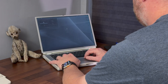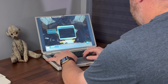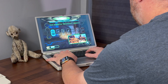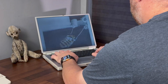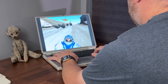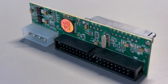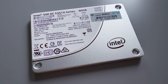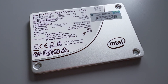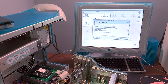Swapping out the drive in the PowerBook G4 was nice and easy — nine screws on the bottom and you have immediate access to the drive. The iBook on the other hand requires almost complete disassembly; I've done it once before and decided never again, so I'll stick with the mechanical drive until it fails. I have purchased a desktop SATA to IDE bridge to try installing a SATA SSD into my blue and white G3, but it's being picky about what it will and won't see. I'll have to look at that another time — thanks ever so much for watching and I'll see you in the next one.